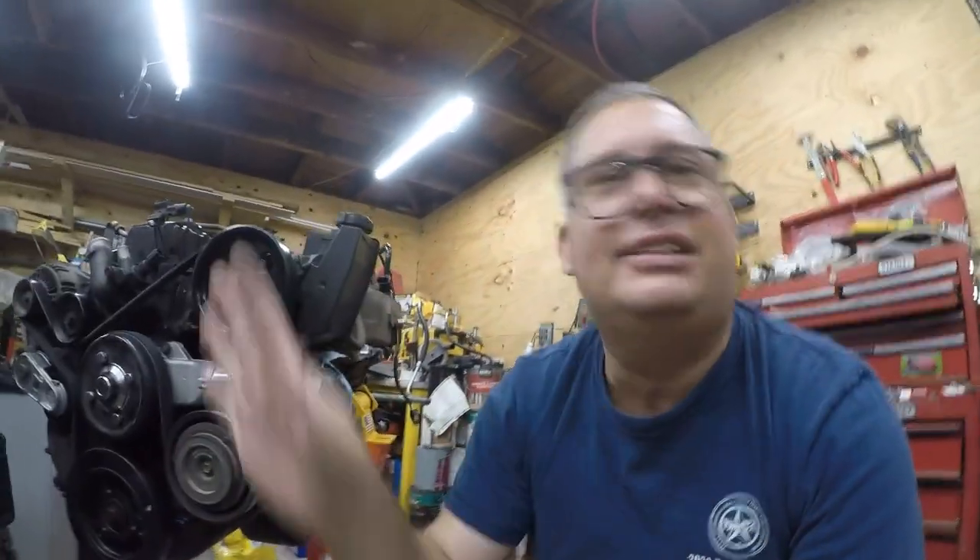That's a pain-in-the-ass location to work on on this engine. The last thing I want is to get this thing running and then deal with weak air conditioning. It's worth $300 to deal with this now. I bought a new compressor on Amazon and a new condenser - both are Densos. The compressor is only 200 bucks, no core charge. I swabbed it with Q-tips and looked for shavings and couldn't find any, but I'll dump the oil out and see if little chips come out.